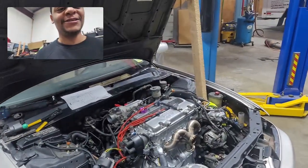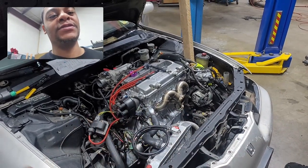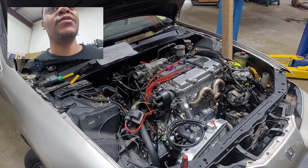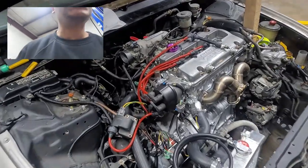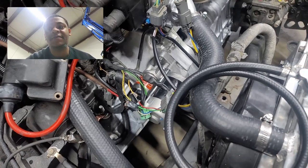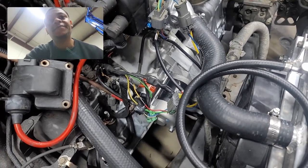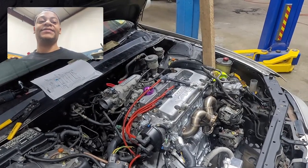Me and Kenny basically getting to the root of everything. I got stuff kind of thrown in there — I'm just trying to get it started, make sure the motor is good, and take it from there. We got the motor to turn over, got the battery in the trunk. The issue we were running into was we have fuel but no spark. Naturally I checked the main relay, the fuses, the ground. One thing I never really went over is that the previous owner — not Tevin, the guy before Tevin — had chopped the harness. I had to undo what he did, and in the midst of that I think I got two wires mixed up. We swapped the wires and we're gonna see if we get spark now.